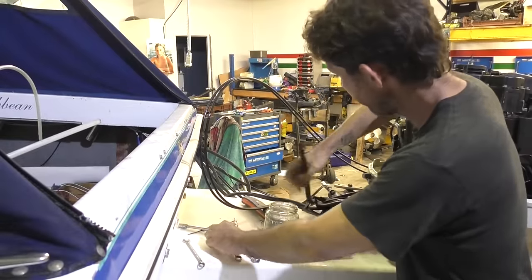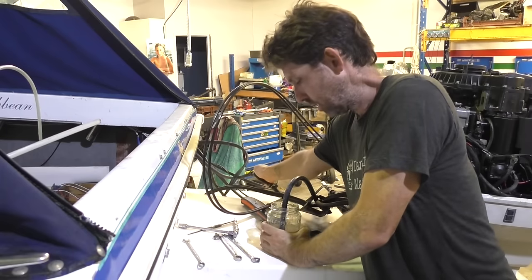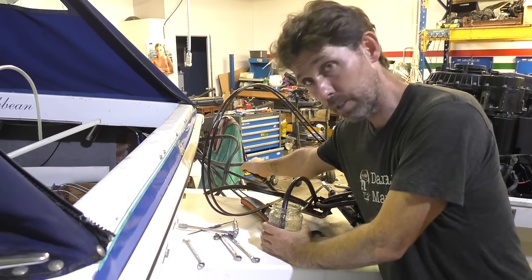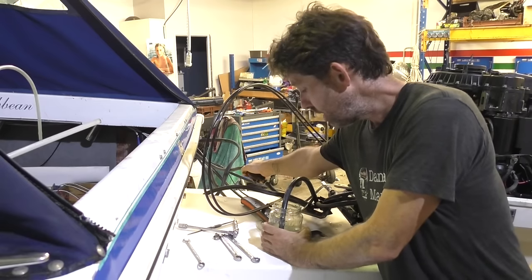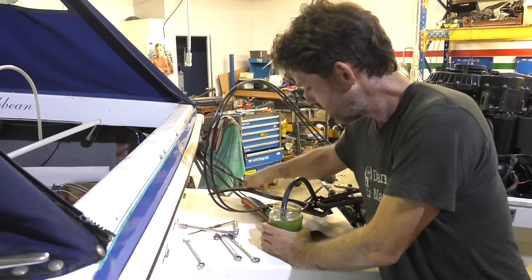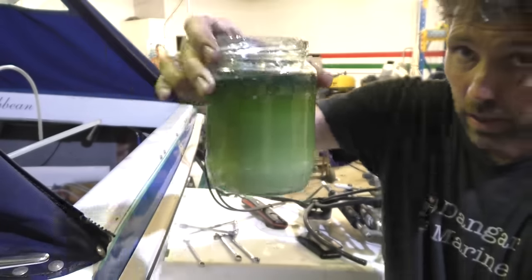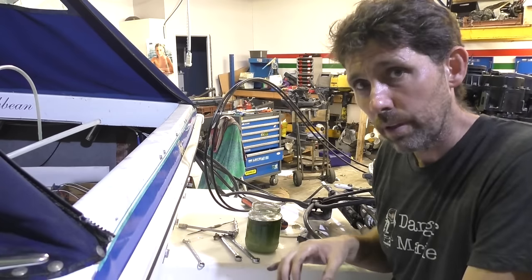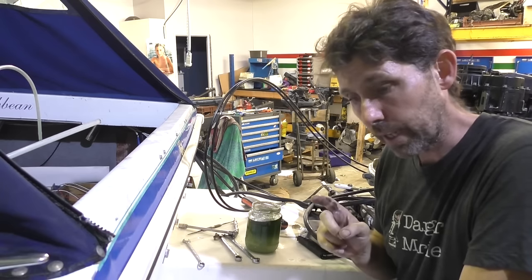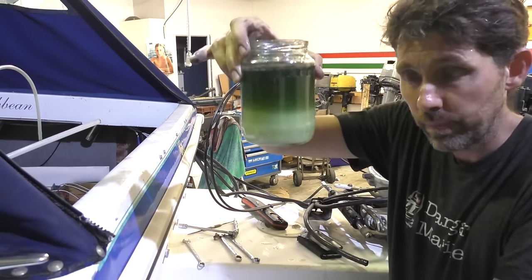I might actually have to prime quite a bit of this because there's a water separating fuel filter that I put in this boat before we first launch it, so that'll have quite a bit of pure unleaded in it — we might do 3 or 4 jars worth just to be on the safe side. That doesn't look very healthy at all, to be honest with you. I'm going to let that settle for a while and have a look at what it really looks like. This boat's been sitting for a while and it's been raining heaps lately, so I'd be curious if water has got into the fuel — because the owner thoroughly cleaned the fuel tank out before its first run, but that to me is looking a lot like water. A lot of water.